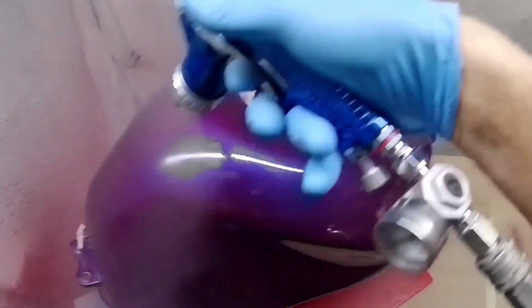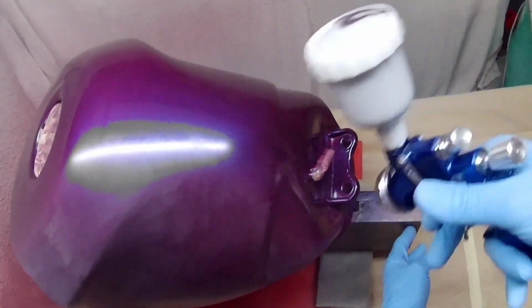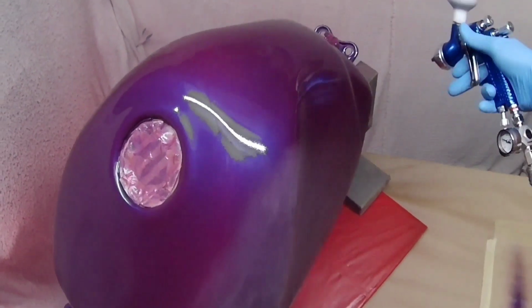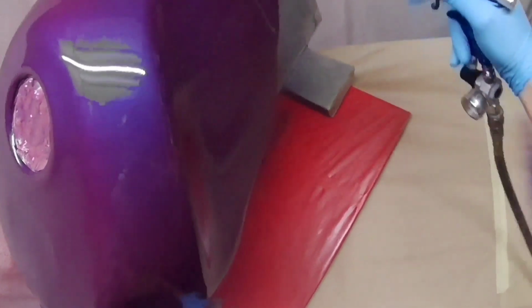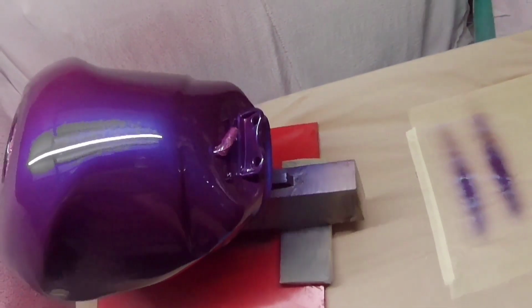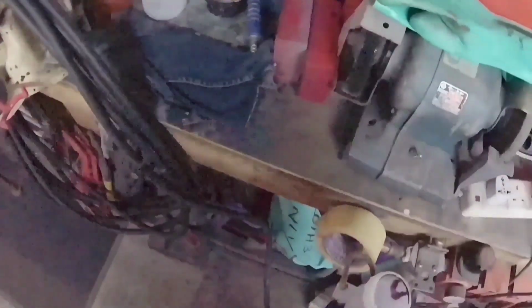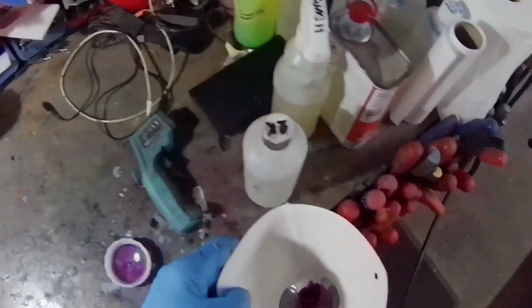Having said that, I presume you know that you can get them from somewhere like Spray Guns Direct. They send to the US. So you can actually get these caps, and they do give a flatter finish than certainly the TE20. The TE25, which is an HV25 cap over here, I'm still using and getting used to, although that actually produces quite a good finish. It's a bit of a hybrid, that cap, but this probably still produces the best flattish finish of any of the Tekna caps.